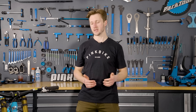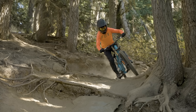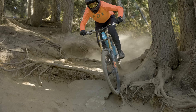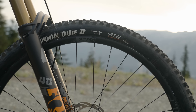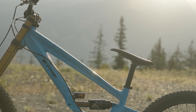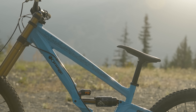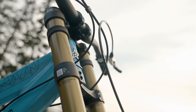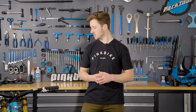The first thing has to be the overall stance of the bike — just how stretched out the geometry is, and it's both a pro and a con. It's a lot of bike to wield, but the overall package is fairly light. I think it could use a little more forgiveness in terms of the frame, and I'm super glad it came with aluminum wheels because carbon would have just been totally overbearing. For such a simplistic bike and the beauty of external cable routing, there is a portion that does go through the chainstay, which takes away the ease of changing a brake line. It could also use a couple more cable clamps towards the head tube — I had to rig up zip ties looped through the fork bumpers to quiet down those cables and keep the rattling down. A little more protection on the chainstay to keep the chain from bouncing against it would also quiet things down further.